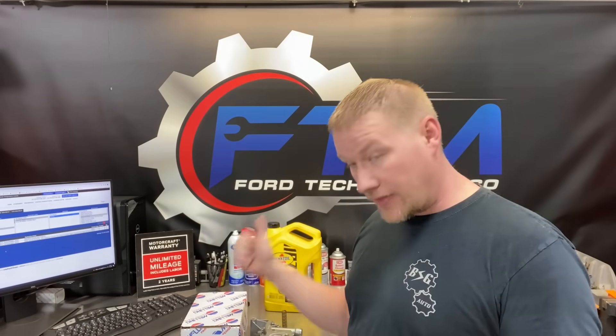This pump is one of those things I would toss in anytime I'm inside one of these engines. The transversely mounted engines have a lot of issues with the internally mounted water pumps failing, and you're pulling the whole front end of the engine apart just to swap the water pump — great time to also change the chain tensioner and upgrade the oil pump. The F-150 models and expeditions have a lot of chain stretch and wear issues due to the extra weight they're lugging around, and this pump is going to provide the extra volume to help with all that.